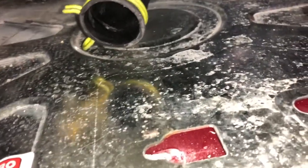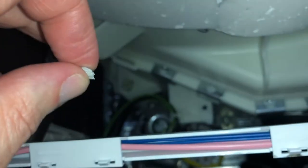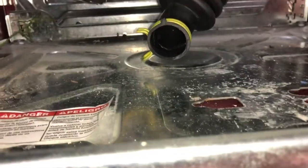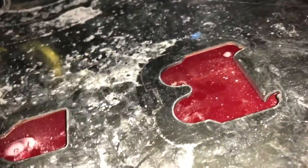Other parts can be faulty too, but that would be a different code — we're working on F21 right now. As far as your external drain hose, clean that out as much as you can. I put bleach down in it too, though it's almost impossible to get really clean because it sits in a curve. It's almost impossible to keep clean back there because dryer lint will accumulate as well. Always unplug everything and turn off your hot and cold water — please. It's very important.